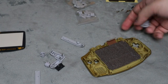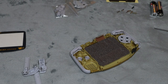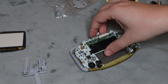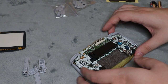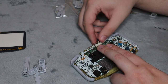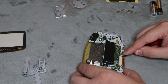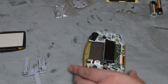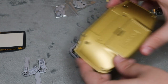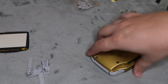Next, we're going to put the buttons back in. I'm going to actually just reuse these buttons here because they are in perfect condition. Next, we're going to be putting the motherboard back in here — just going to set it down. And you do have to plug that cable back in, so the same way you pulled it out, you're just going to push the pins back in and then click the clips on each side down, just like that. Then push in on both sides. And now you can put the two screws in to hold the motherboard. Now you're just going to put the back cover on and put the screws back in all around it. Now that you have all of those screws back in and it's back together, you're just going to flip it over.